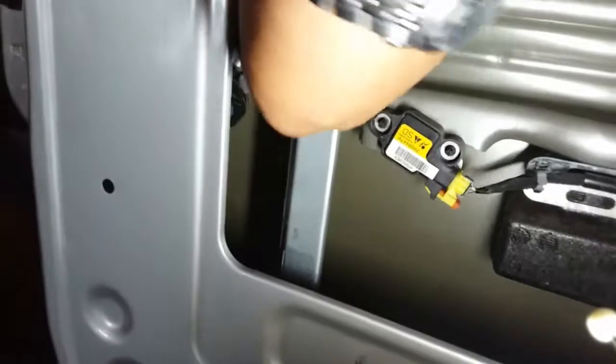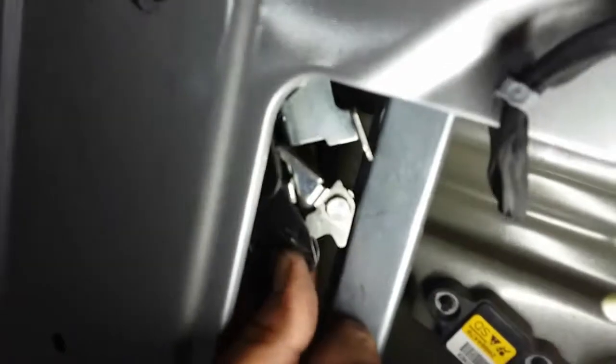You're able to pull this out forward. Then you'll have access to pull this forward like so, and you grab your needle nose and you pinch this end and pull it out from right there. Just wanted to give a quick explanation of how you remove that cable, because that cable has to be replaced for this door panel in order for the door handle to unlock the door from the inside.